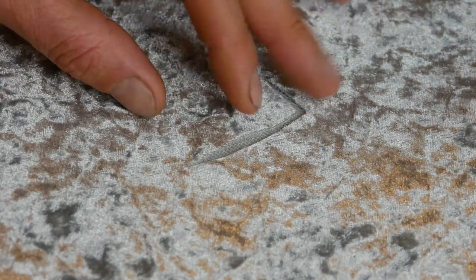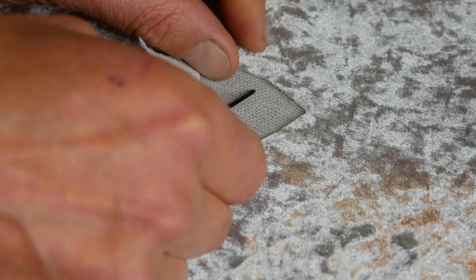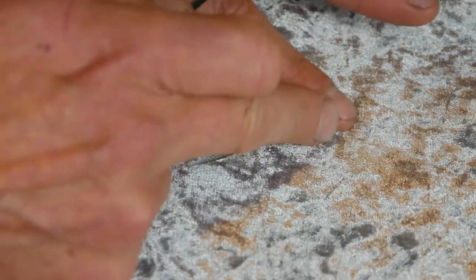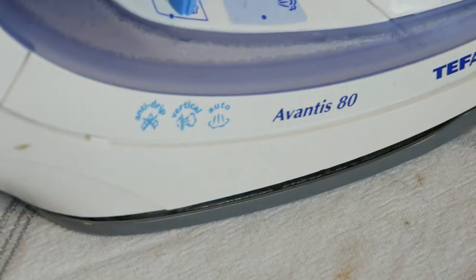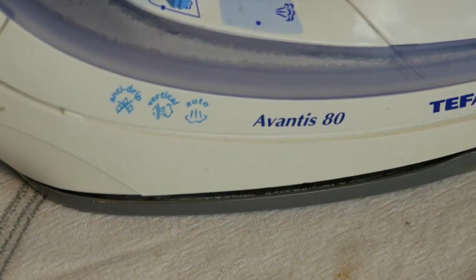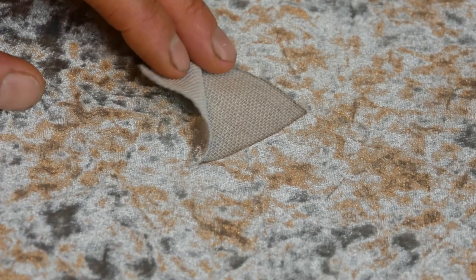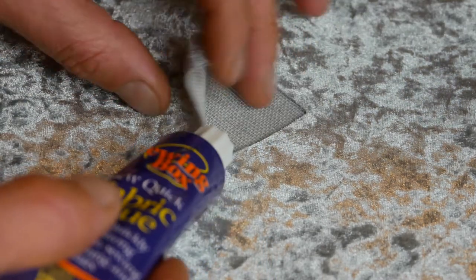Once you've got that how you want it, all you have to do is apply some glue using a little piece of cable tie, pry up the edge slightly, and apply glue all around the edges — reaching under there to do all of the edges like that. You're just doing the patch at this stage. Once you've got glue all around the edges, it's similar to the process already shown. Put a cloth on to protect your suede or Alcantara, iron it down exactly the same as before, and give it time to dry. Once all the edges of the patch material are stuck down, it's just the same as what was shown — tidy up those edges and then go ahead and glue the top piece down.